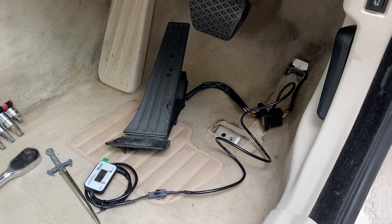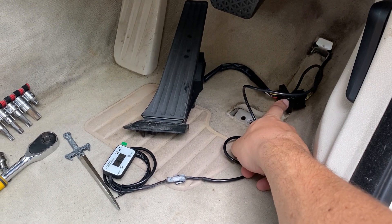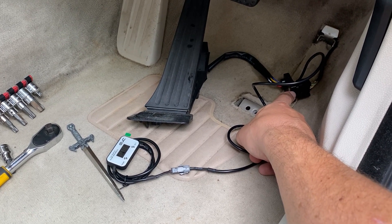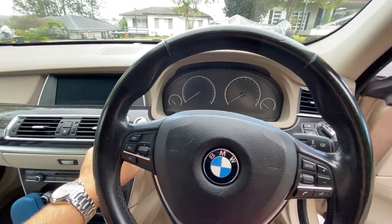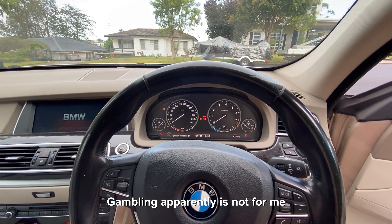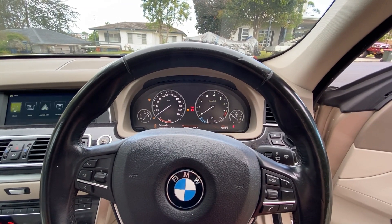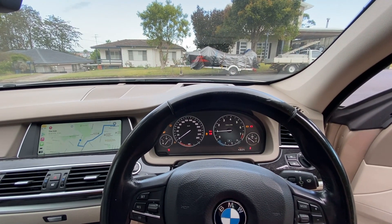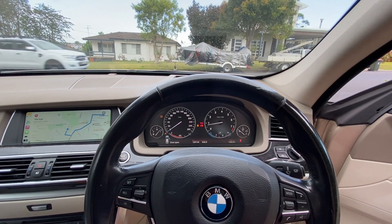We want to just stop and start the car. The body side of this loom is not numbered, so there is a chance you can connect this plug the wrong way around. If that happens, you'll get a series of errors on the dashboard. So we're going to start the car. All right — to me that's a good sign that I have things plugged in the wrong way. We'll switch that plug around and try again. Plug switched around — let's try again. All right, car stays running. Very good.